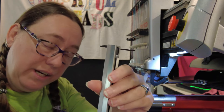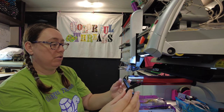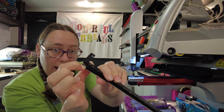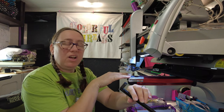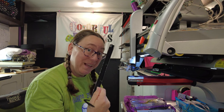I'm going to post a link where you can buy this assembly down below, and we're going to figure out how to replace this. This one is an actual damaged one. I'm going to take mine off the machine and then put it right back on. When it gets wide and damaged from the back, it doesn't trap your threads and hold them in place, and they get caught up in your sewing causing problems. So we're gonna see how to replace this.